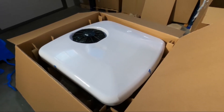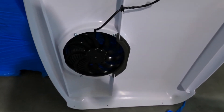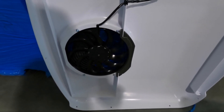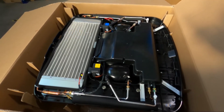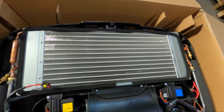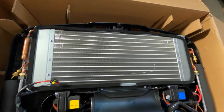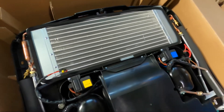So this is the outside. We will take the top down to look inside and see the main components. On the top case of the unit there is a fan which ensures condenser cooling. Moving inside, we can see the condenser — this is also what you have in front of cars for the AC. This is where the cooling gas transforms from vapor to liquid.